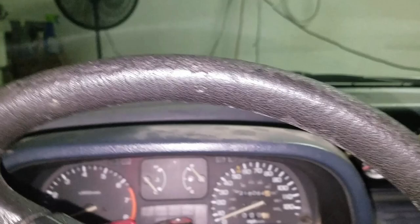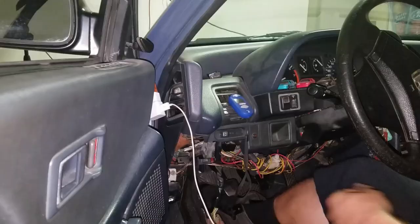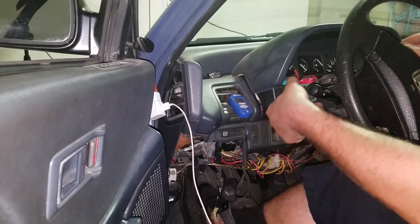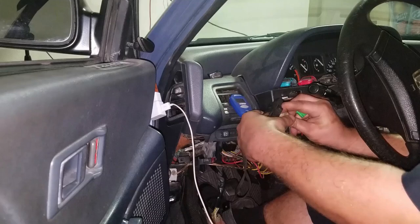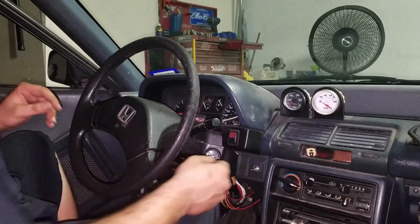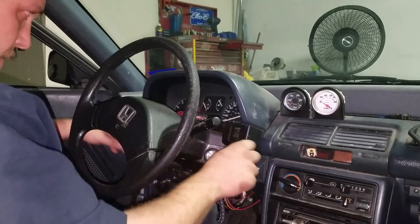After you have the two screws popped out from the tabs, come inside the car. We'll have to disconnect the clip that goes to the back of the buttons on this part of the cluster dash. Just lift that part of the cluster up and from the inside push it out, then pull it out and disconnect these clips - that one and that one. This button comes out; set that off to the side. Now the only one we've got left is the hazard button, so go ahead and pop that one out, disconnect that clip, and that button comes out too.